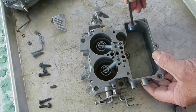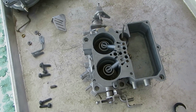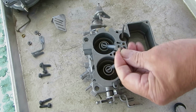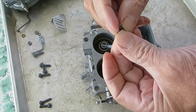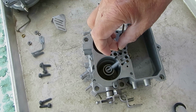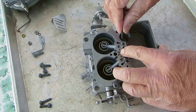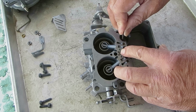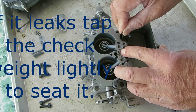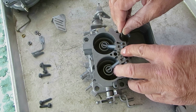Let's get some more fluid in there. I'm using mineral spirits for fluid — it seems to mix with gas pretty good and you can buy it odorless. So here's your check weight here. Some carburetors use a check ball and a weight, and this one uses just a check weight. You put it in there like that, and I'm just going to hold it down with a little bit of pressure and press down that pump. And you can see it's holding it really good — I'm getting some good pressure. So you take the pressure off and it allows it through.